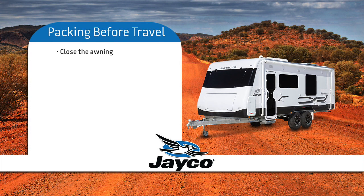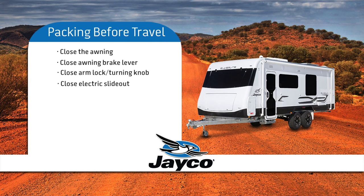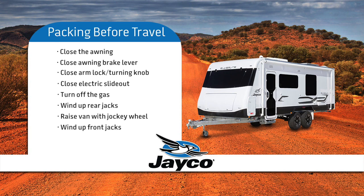Close the awning. Check that the brake lever of the awning is in the closed position, as well as the arm storage lock, and that the turning knob is tight. Close the electric slide-out. Turn off the gas. Wind the rear jacks up. Put the jockey wheel into the bracket and raise the jockey wheel until it is lifting the front of the van. Wind up the front jacks. Lower the jockey wheel so the hitch on your van can catch onto the tow ball. Release the handbrake.